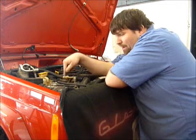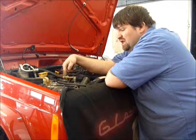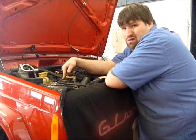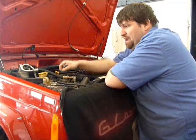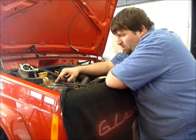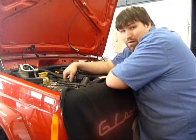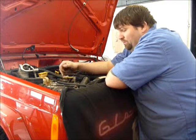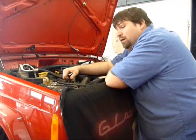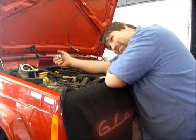Well, battery terminals on this thing, it's got the original positive, which is just a really poor connection, and people jump-started this thing multiple times, probably had a bad battery. Actually, I know for a fact it had a bad battery, because there's battery acid marks all over the hold-down, but this is a relatively new battery. By the time we're done, we're going to have to put a couple new terminals on this thing. But I got those all cleaned up, got them tightened down. Can we see if the engine cranks now?